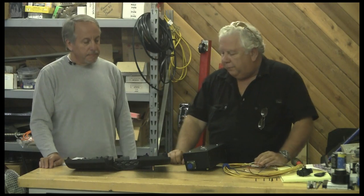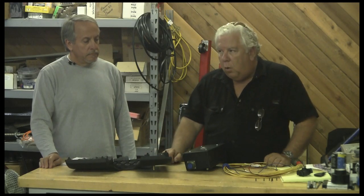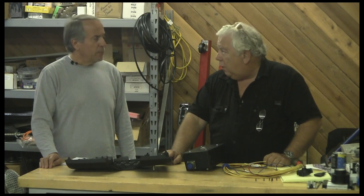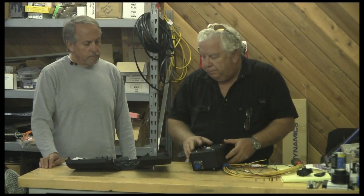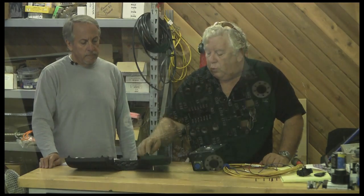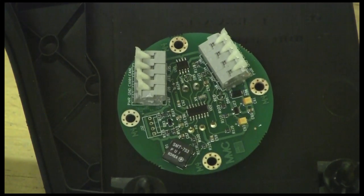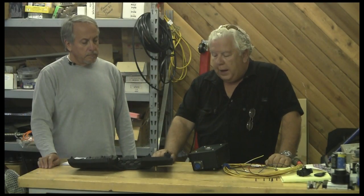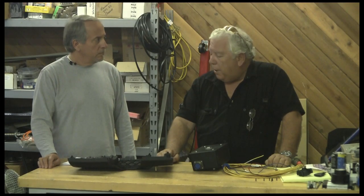They're connected by four wires: a high and low on the transmission, a ground, and a power wire system. We'll run that from our main circuit box to this HMI — we've got a four-pin plug there — and then from the four-pin plug on the other side of the HMI to the display. The display has four CAN bus wires that hook up to this, and then a fifth wire, a little white one, which is a pulse-width-modulated output representing state of charge.